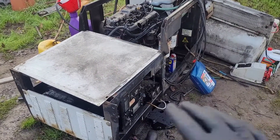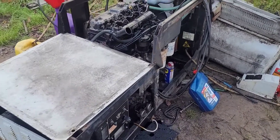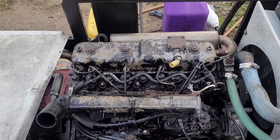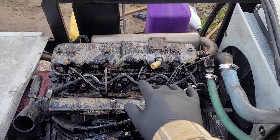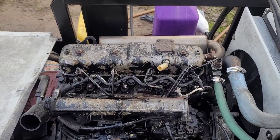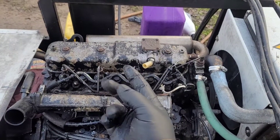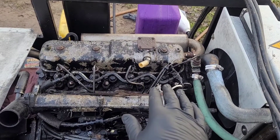A couple days have passed. I learned some devastating news that I already suspected — we had problems on number four. Did a compression check with my calibrated Harbor Freight diesel compression meter. I know it reads wrong, but the front three cylinders have good compression and the back one has nothing. So that has to come off so we can look at the damage.